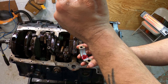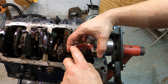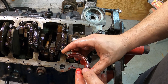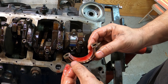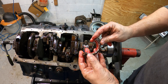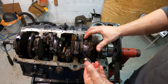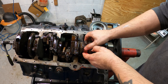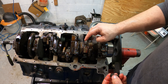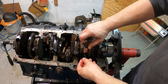Very simple — squeeze the assembly lube. It's a little overkill but just so you can get a dramatic effect through the sides. See the radius here — how it's protruded out versus this side which is actually flat? It goes along the side of the crankshaft over here. Can't screw that up. Also, when you're taking apart an engine, mark the actual rod caps so you know — just as a double check. Since we have all that oil coming off the piston, the rod bolts are all greasy and full of oil, so instead of having to put any lube on the bolts, they're already oiled down and ready to be torqued.